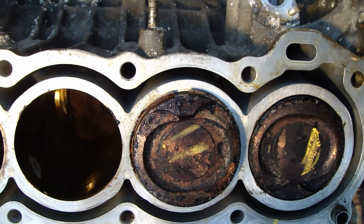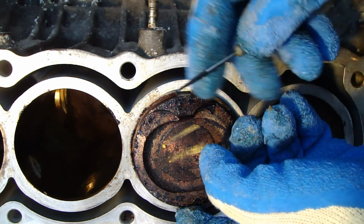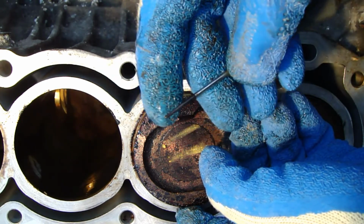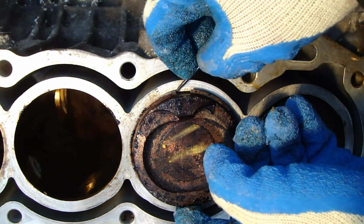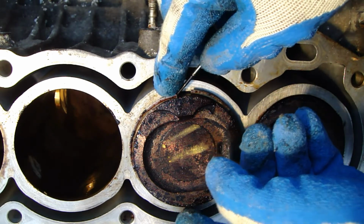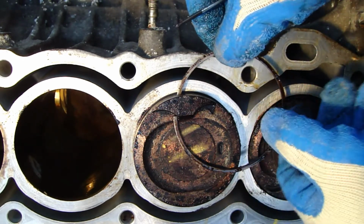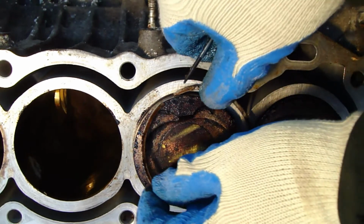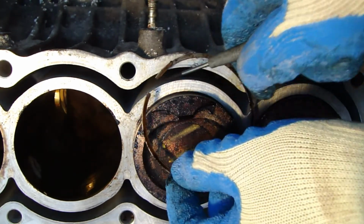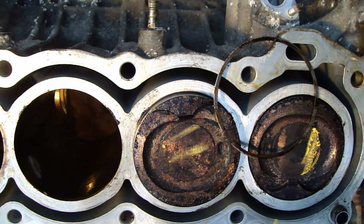First I insert my finger in there, I press this piston ring, and then I have a small screwdriver that fits in there. There is a trick: when you move that up a little bit in here, this carefully opens. Be careful, because this piston ring can break. And then this final part in here. Okay, and this was the information on how to take this piston ring out too.